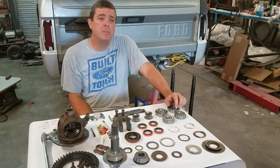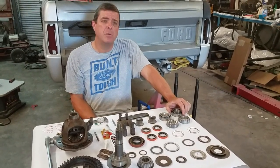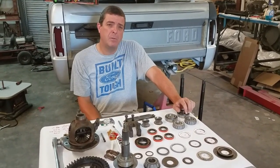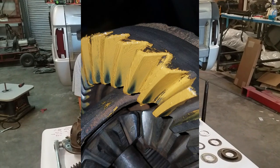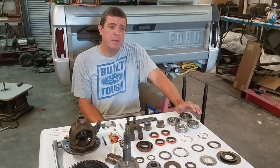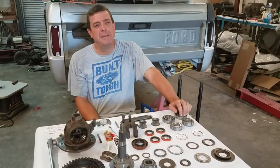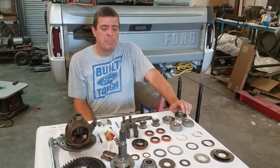As you noticed, I didn't put out a video last week. We were in the shop, we made a video, and I was getting towards the end when I found out the gears weren't good. I was going to try to reuse the original gears. I had the pinion depth right, backlash was good, but I just couldn't get my pattern where I wanted it. I had to buy a couple extra bearings just to redo it, and I'm not going through this much work to have that thing whine. It kind of put me down a little bit, and I felt like I needed to walk away from the shop. I'm sure you guys have that issue too sometimes, but we're back out here today.